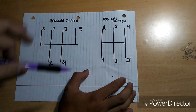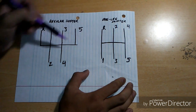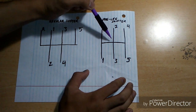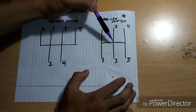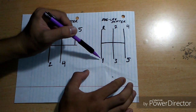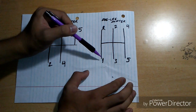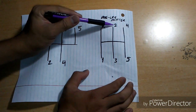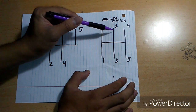So how do you shift on a dogleg shifter? Your neutral position is right here in the middle, same as with the regular shifter. To shift from neutral to first on a dogleg shifter, you go left, then down. To go from first gear to second on a dogleg shifter, you go up, right, then up. You're in second gear. To go from second to third, you go straight down.